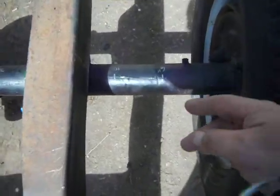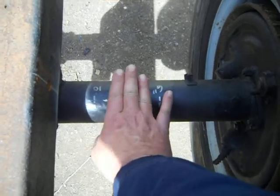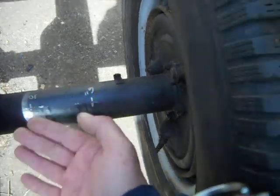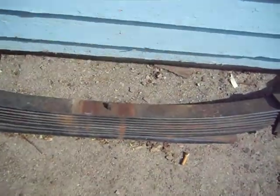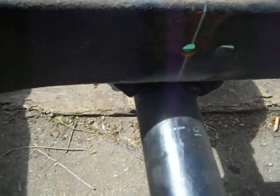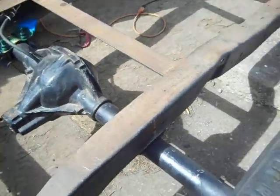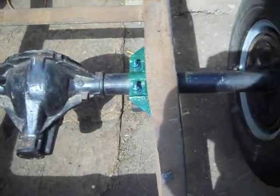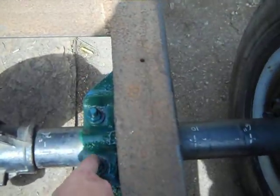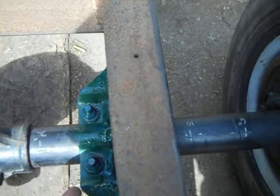I removed the little saddles that go on here that are curved. They fit underneath your leaf springs because this was under-mounted — not an over-mount, it was under-mounted underneath the leaf springs. There are little saddles on there; they're hard to see. They're just moved over and welded. I'm thinking about going with this. I can get U-bolts, probably about $25 for four, and put U-bolts around the rear end. This is the holes where the U-bolts went through. I can duplicate this on the other side, but I think I'm going to go with this.